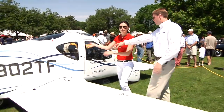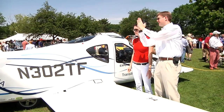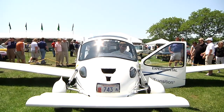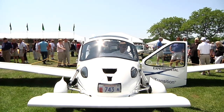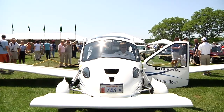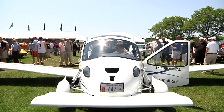The root folds up like this and the wings come together. In order to convert the vehicle from flying to driving, you've got to be stopped on the ground and shut down your engine. Then you switch your master switch over to wing-folding mode, enter a personal identification number on a keypad for an extra level of security. Once you do that, you can unlock the wings manually and push the buttons to fold them up.